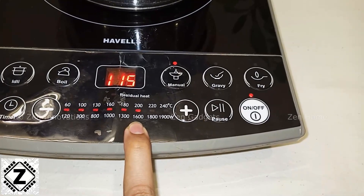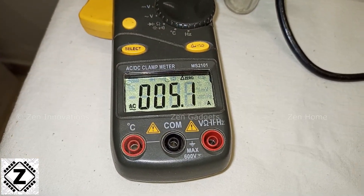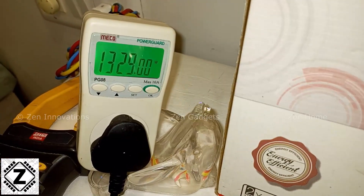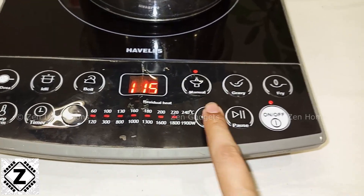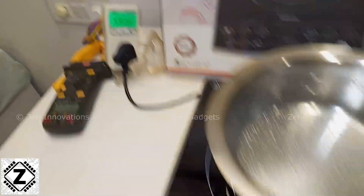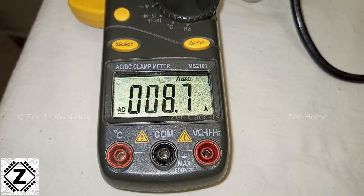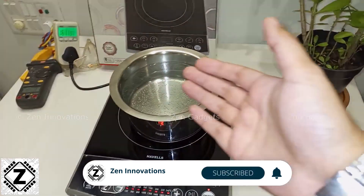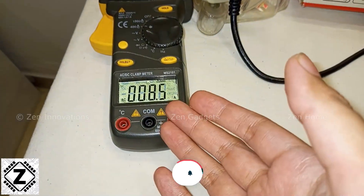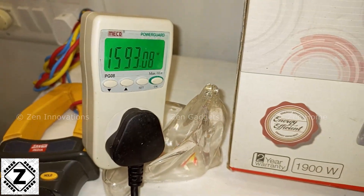Let's go further — I'm going to go to 1600. At this 1600 watt setting, we can see on the clamp meter it is consuming 5 amps from the wall socket, and on the power meter I can see that 1300 watts are being consumed. Let's go all the way to 1900 — the highest setting this thing can run at. The wattage being shown is 1600 watts with a peak power consumption of around 8.5 to 8.9 amps. So if you want to run this thing at full power, make sure that your solar energy setup or inverter is able to deliver at least 10 amps for effective running of this machine.